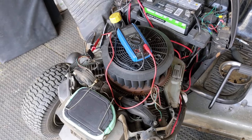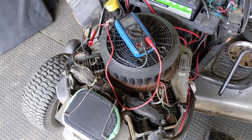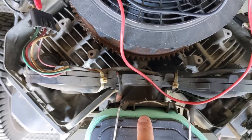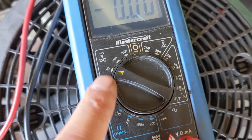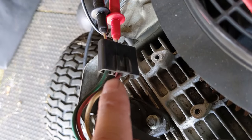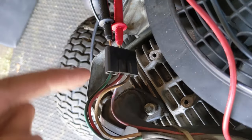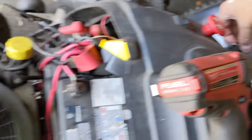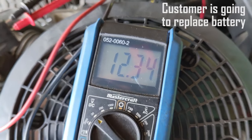I try to keep things as simple as possible but I always try to do a professional job. So I got the multimeter out and I'm going to rewire this myself. I've back-traced the wire that we need to supply 12 volts to the fuel solenoid — that goes into the red wire there. I've taken my multimeter set to 20 volts DC, taken the red lead and stuck it into the connector that goes directly to the fuel shutoff solenoid, and taken the black probe and stuck it into the green wire for ground.